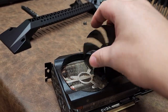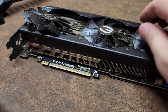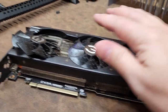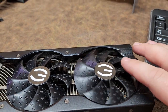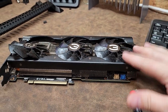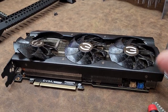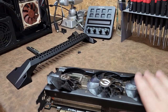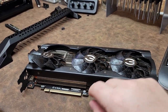I just need to do some cleanup and whatnot. I got it at a steal of a deal, but nonetheless, always inspect beneath your fans for debris. A couple of these fans were completely occluded underneath — it was jam-packed. If I had noticed that, I would have told them to shove off, because that means this card was run hard and put away wet, per se. But anyway, it's going to work fine — I just need to show it a little bit of love. Probably when I'm done giving it regular maintenance, it's going to work better than new.